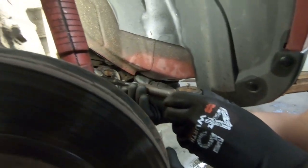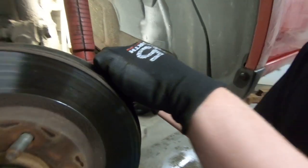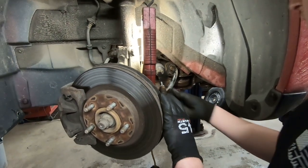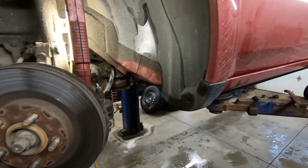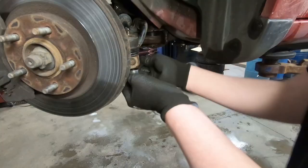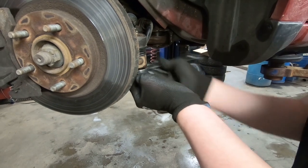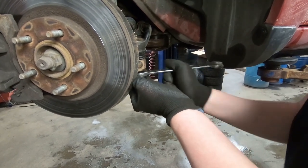So what we'll do is just pop it right back into the socket. Put that nut on there. It's hand tight. Okay, now take your castle nut and spin her back on there. And once you get that cinched up, I'll grab the pry bar and pry down on it. You can tighten up so you can't tighten any further. Nope.